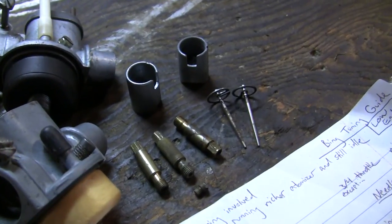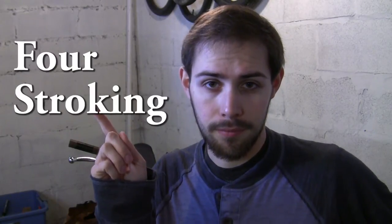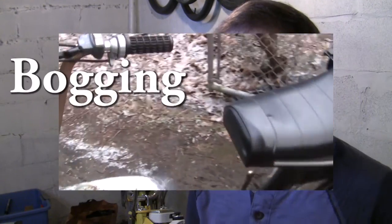So you're asking yourself, what parts do I install? There's almost an exponential number of different combinations of parts you can put in your carburetor. The safe way to do it is to start rich and go lean with your components. Two things you want to listen for: first is any four-stroking, or any time you're bogging when you nail the throttle. If you're four-stroking, that means you're definitely rich at that throttle range. If you get a gurgling sound from your air filter and you're bogging, that could be either a rich bog or a lean bog. It's safest to start rich and work your way lean, so you don't risk seizing anything or causing any damage.